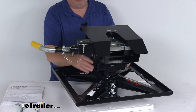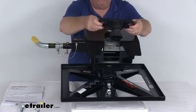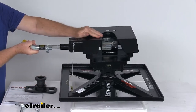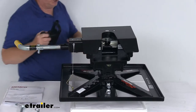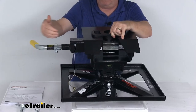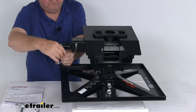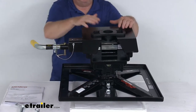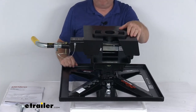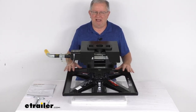Here's a demonstration using an example kingpin from a fifth wheel. Open it up, remove the safety pin, and pull the handle all the way out — you'll hear it lock in the open position. When hooking up, the kingpin slides right into the jaw, and you can see it automatically slides across that thick bar and locks into place holding the kingpin. Your handle is now lined up; slide the safety pin through and clip it to keep the handle from opening. To remove, just take the pin out, pull the handle open, and it releases from the fifth wheel head. That covers the review on this Demco Recon Gooseneck to Fifth Wheel Trailer Hitch Adapter for the Recess Gooseneck Hitch Ball with 21,000 pound weight capacity.